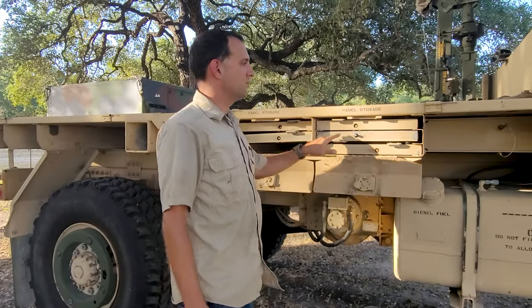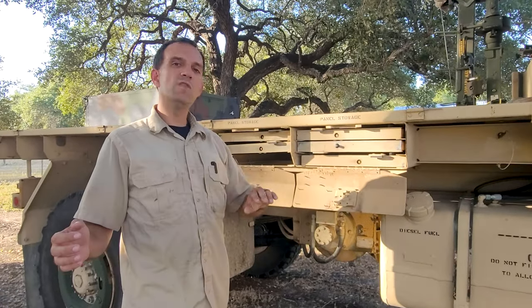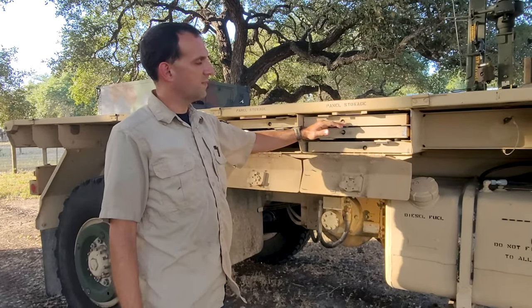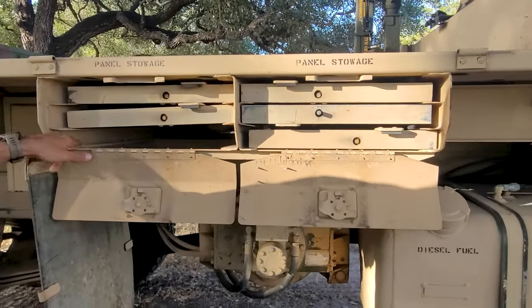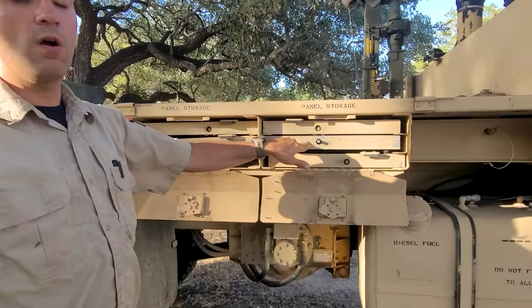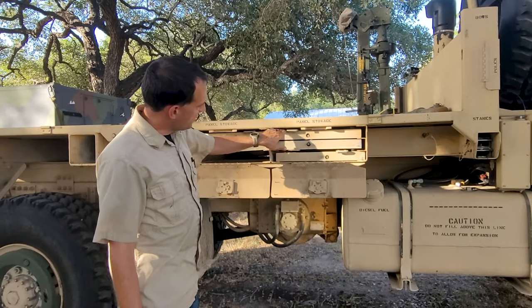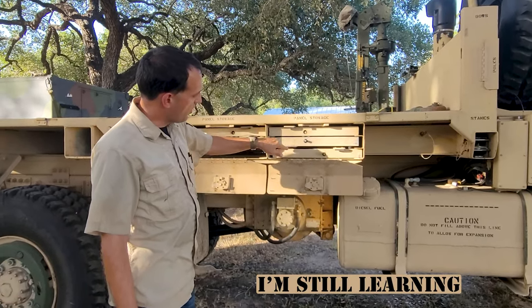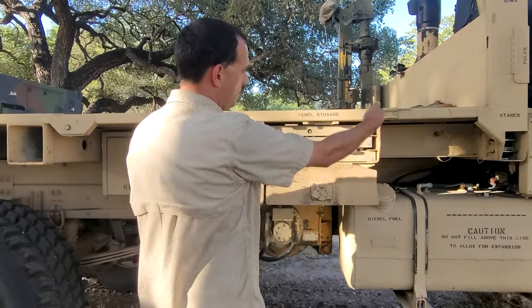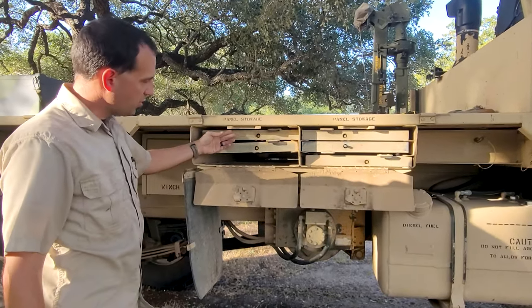Basically, from my experience, every single one of these trucks is a little different, and what you've got to do is find which panel fits in which part the best, and it's not going to go in and out smoothly. I found here on this truck, this one never works well because you have the bolts going through it for the mud flap. My center tailgate goes best in the middle because that's the hardest, longest, biggest, heaviest one to put in. And then they're staggered. You can see the outboard part going up, outboard down, outboard up, and also the hinge side alternating so they're not hitting each other. And then not so much over here.